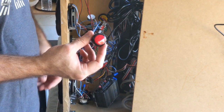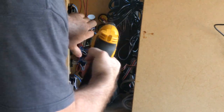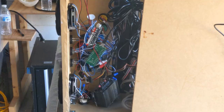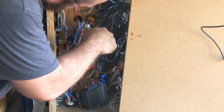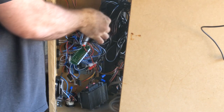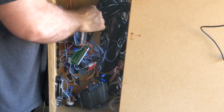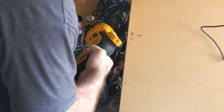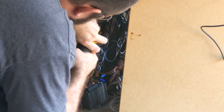Now it's time to insert the first Sanwha button. I drilled a new hole with the 30 millimeter circle drill bit, drilling from the inside out to make sure I cut an even hole through the acrylic. I would recommend using needle nose pliers for removing the old wires. I'm going to keep the buttons loose on the other end with just the wires plugged in so it will make it easier to clean before assembling the control panel back together. I continued this process for all the buttons.